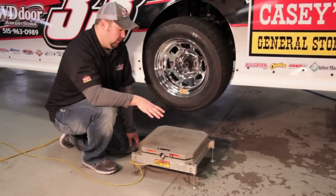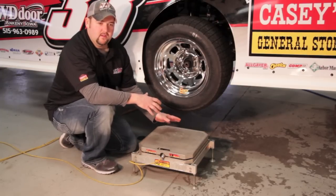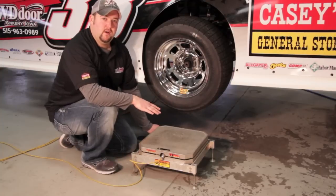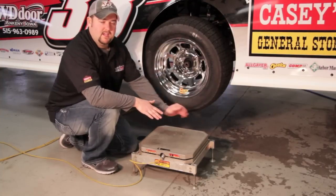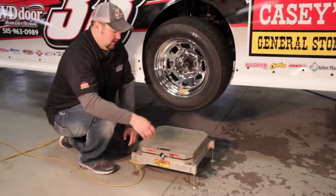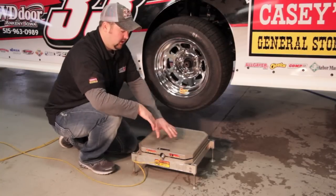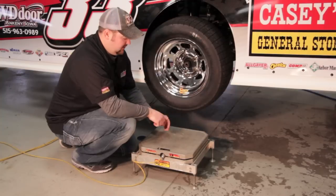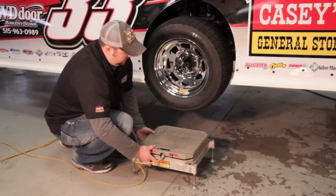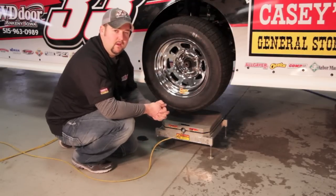Before we set the car on the scales, I wanted to show you a bit more detail about what a scale is and how we set them up underneath the car. I choose to use Long Acre scales — there are different scale companies out there. I always want to have a tall stand for the scale to sit in, so it's easier to get under and make adjustments while you're scaling. Some guys do it on the floor, but you've got a really tight space underneath there. The other important thing about your stand: most concrete floors are not level, so you want some sort of adjustment — whether bolts or pads — to get the scale level. You want to level each pad perfectly, and all four pads need to be the same height. We usually mark the floor for where our pads sit to stay consistent every time, giving you consistent scale numbers.